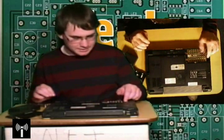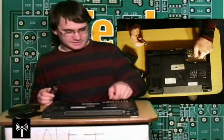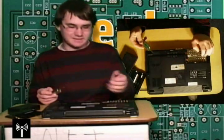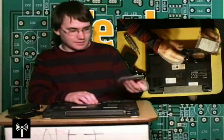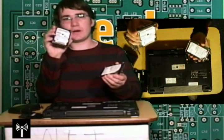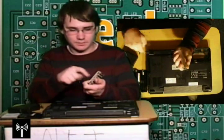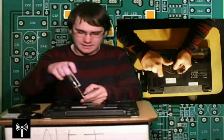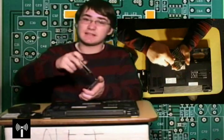You should be seeing something like this — you've got a little wire mesh casing and a nice little tab to pull. The hard drive — normally there would be two screws here and here, but I've already taken this laptop apart so I left them out to save time. You just want to pull on the tab, the hard drive slides right out, and this is what you're left with. As you can see, it looks very similar to the external hard drive, except you want to take the one from your laptop out of the wire casing. The wire casing just provides a bit of extra security and prevents you from touching the underside of the hard drive, which is the most delicate part.